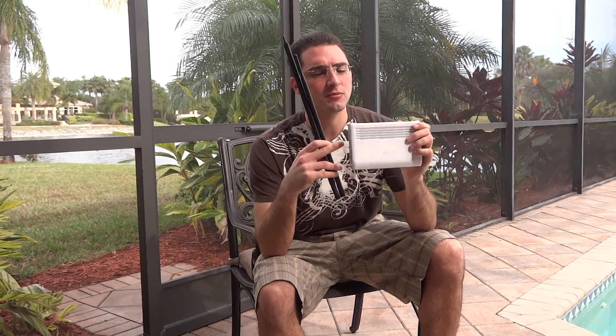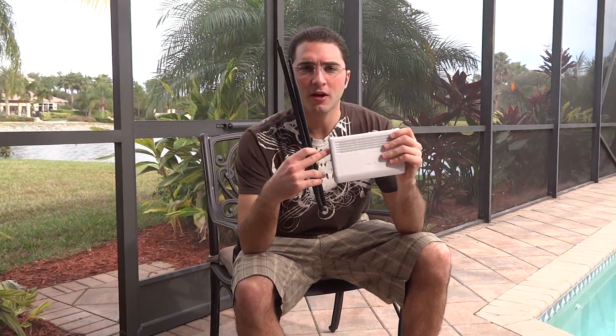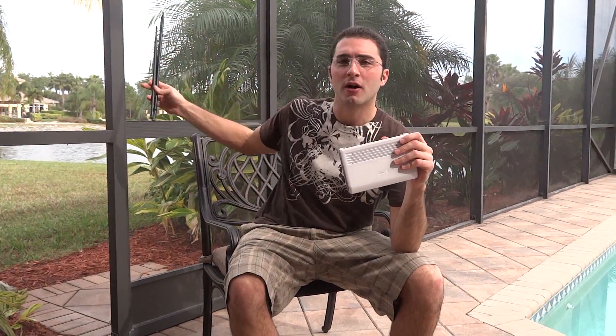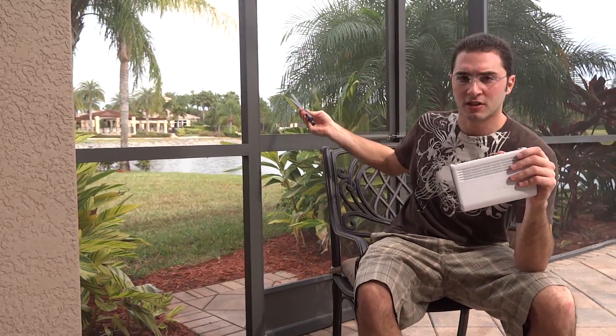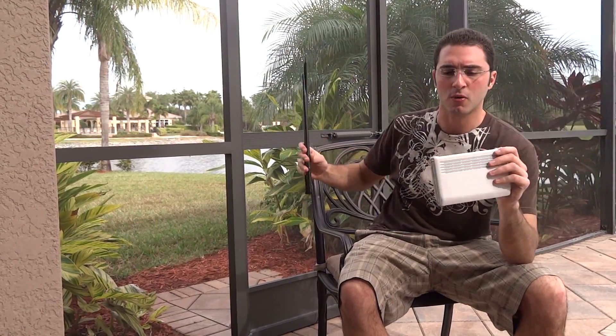You could take just about almost any router — I suggest a high-powered router and one that has the capability of adding external antennas — and have a router set as something called a client bridge, so you can program your router to get internet from somewhere else, whether it's your neighbor or in this case the clubhouse. There's a clubhouse right behind me, and in the clubhouse they have free internet for all the members. So we're going to eliminate our high-speed internet bill by programming a fairly basic router with a custom firmware.